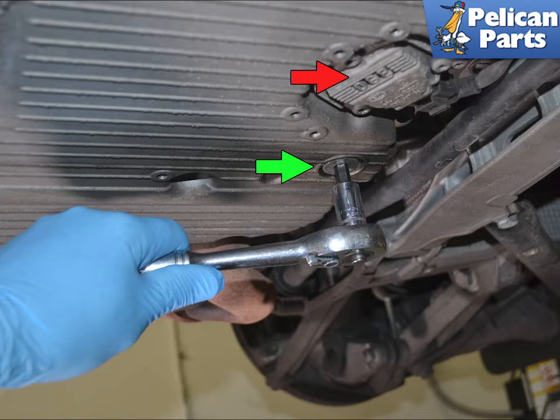The sump also adds an additional drain plug for faster or more complete oil draining. The kit includes two new LN magnetic drain plugs along with a pickup tube extension to ensure the added oil can be utilized. The factory oil control baffle and oil level sender bolt on without any modifications.